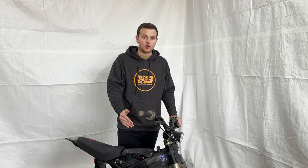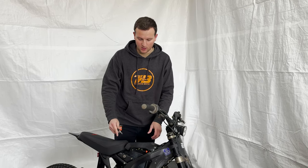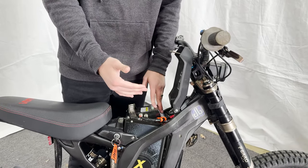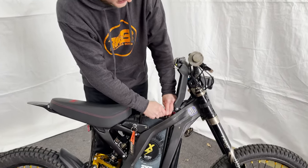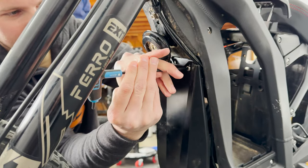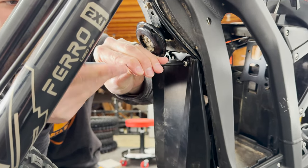It is now time to install the upgraded TM25 motor. We're going to go with pretty much the same process as the controller: turn the bike off, take the battery out so we're safe, because we are going to be disconnecting those motor phase wires from the controller. Unplug the battery, take it out, then drop the skid plate and start getting the motor off. First step is to get our controller cover plate off so we can access those motor phase wires.